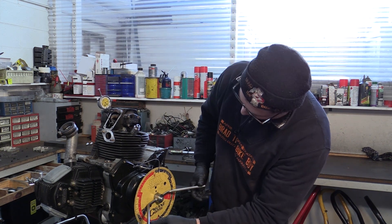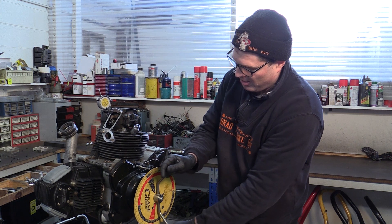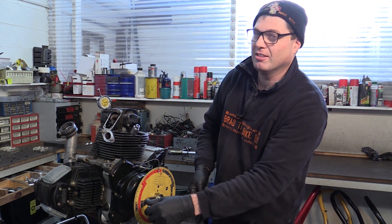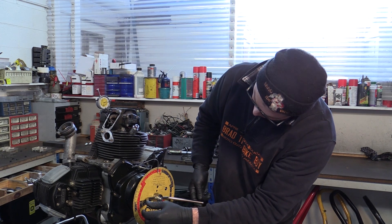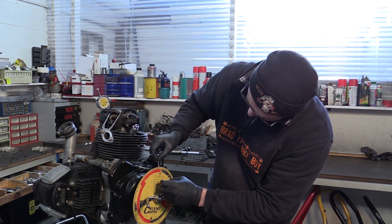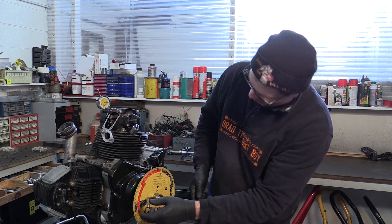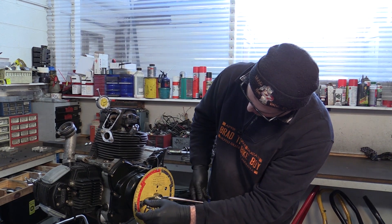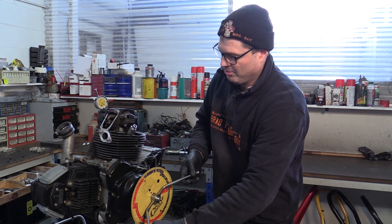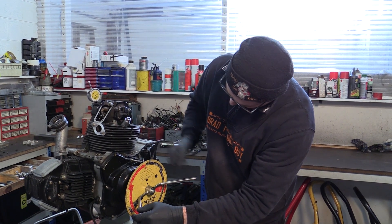It's stopping at 11 degrees after top dead centre. So we go around the other way — the exhaust valve's opening now — and we'll see what we get. Just move it around and it'll stop. Don't spin it crazily fast and mash your piston into the stop. That's about 13 and a half, so I need to set it about 12 and a half. All my stop tools are usually bits of bent coat hanger — very handy. That's about where it stops, and that is now on 12 and a half degrees. Going back the other way it's about 11 and a half degrees.